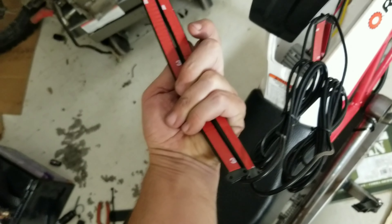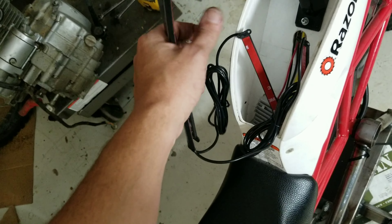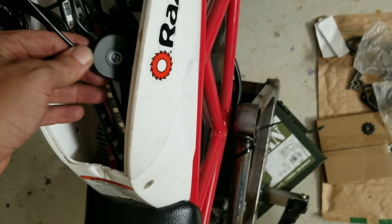There's double-sided tape here. Use rubbing alcohol before you mount it, and then they'll lay in real nice and flat. There's your voltage reducer, and then we'll run it off of this switch right here, so it'll look factory. And then of course you'll have your music, lights, and USB charger.